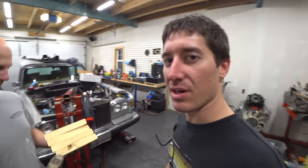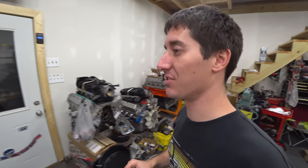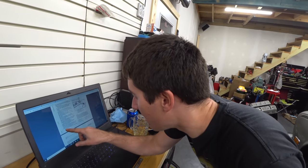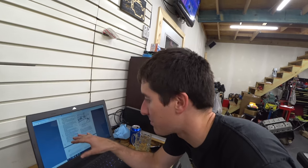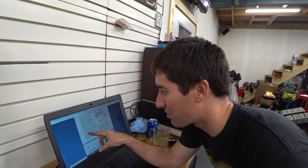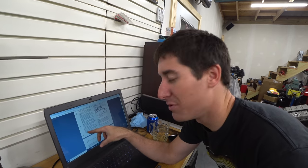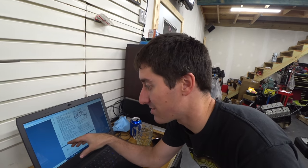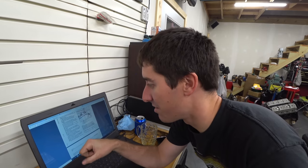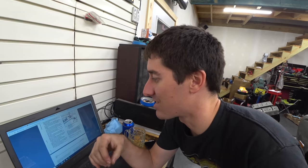All right, so the fuel tank is glued down, and we just read the factory workshop manual here. I'll read it to you because it's a great manual to read. After a while, carry out an examination, skip that part, drive the wedges between the bottom of the fuel tank and the luggage compartment floor. Ensure that the wedges do not exert too much force, otherwise damage to the fuel tank may result. The fuel tank may not become free instantaneously, as separation may be a gradual process. Therefore, the wedges should be left in position for a period of time. And it says continue to repeat the exercise until separation takes place and the fuel tank can be withdrawn.